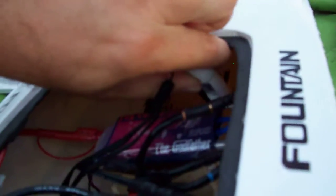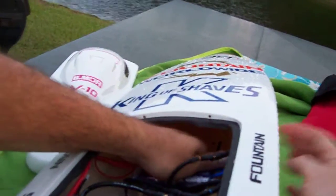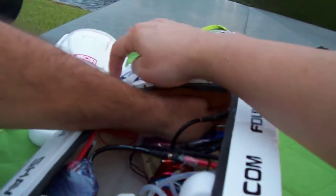92 on the cooler, but there's really nowhere to check on the ESC — everything's underneath, it's cool. Check the cooling — getting up to 95. Espen, the water for the motor comes out the right, and the water for the ESC exits on the left, even though the water comes in and splits — the motor gets cool water. 97 degrees is cool; it's not hot at all.